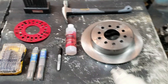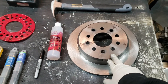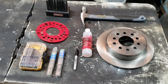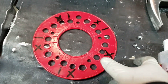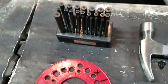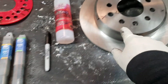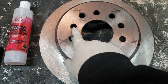You can see that the rotor does fit on the axle now — everything looks good. Here's everything I used for this project: the bolt pattern template, which shows the four and a half and four and three quarters sizes; the punch set and a hammer; and a Sharpie to mark everything so I was sure I was drilling the right holes and not the originals.